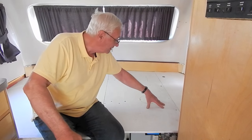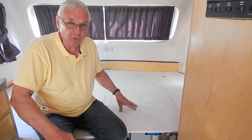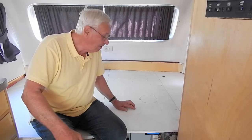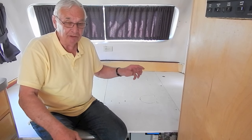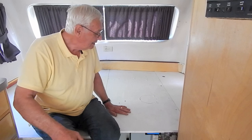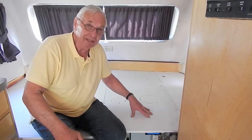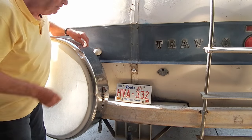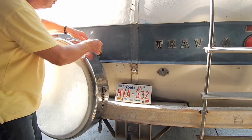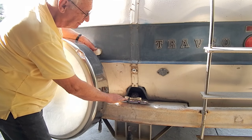The reason I made a new water tank was that while having the motorhome moved, somebody accidentally put gasoline in the water tank filler pipe — an innocent mistake since it looked just like a gasoline filler cap, while the actual gasoline filler is hidden behind the fold-down license plate. We were never able to satisfactorily clean the original plastic water tank, so I went ahead and made a new one. The water tank fill is now a piece of threaded PVC with a white plastic screw-on cap.